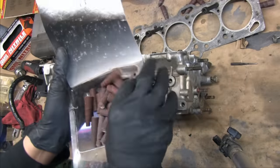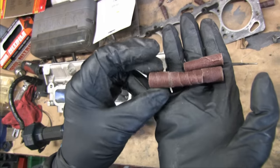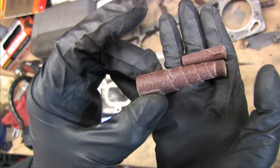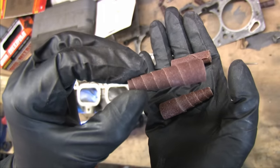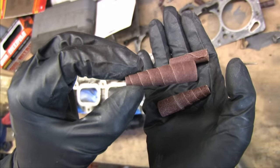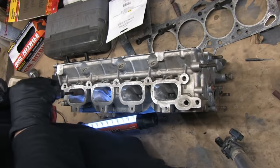I've left the floor rough, and I feel I'd be making better use of the rough floor if the roof and the bowls were sanded to a much smoother finish. That way there's a more drastic difference in the textures and airflow characteristics on opposite sides of the same port. So we're going from the 80 grit sanding rolls to 120 grit and making another pass.